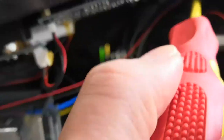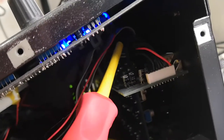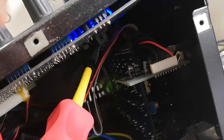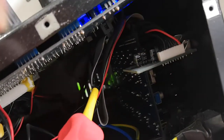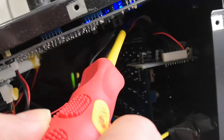When you are taking the ribbon cable out, spend a bit of time cleaning the connectors — rubbing alcohol with no water, obviously, or compressed air will do the job nicely. Also make sure you inspect both ends of the ribbon connector itself in case there's a tooth of the ribbon connector that's not quite properly in the cable. Worst case scenario, just buy a standard ribbon cable and replace it. I don't know exactly how many cores this one is, but it won't be too difficult to work out by counting them, and you can get ribbon cable everywhere — it's very easy to find.